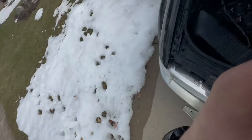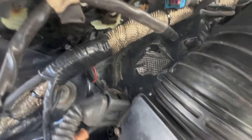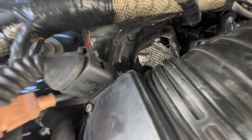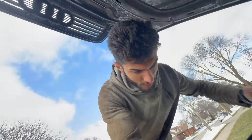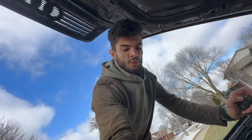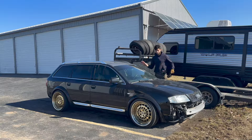It really did smell like oil, so I think maybe the timing belt cover gaskets are leaking. We do have some smoke coming out from here — could be oil, most likely is oil. Potentially the covers on the back of the cams got melted and are leaking oil; they definitely did get a little warped. It could also be coming from the valve covers. We'll look into it, but she made it home and made some cool noises.